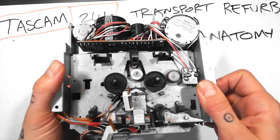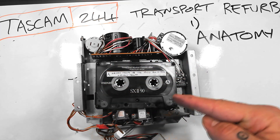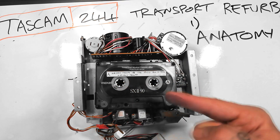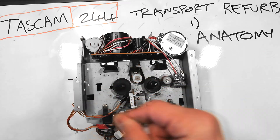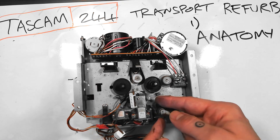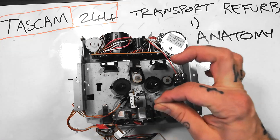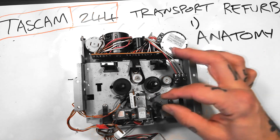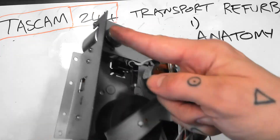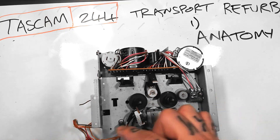I'll just simulate that by manually turning that white wheel at the back. Your cassette is sitting there and it's travelling around here, going past the magnetic heads and through to here. So this would be your supply reel and your take-up reel. That movement is created, at least partly, by this pinch roller — this rubber part here — pressing against the capstan. The pinch roller doesn't have any movement driving it; it's just there to create pinch so that the capstan will tug the tape through at even speed past these heads — this being the record and playback head. That's what the capstan motor is doing; it's the main one responsible for ensuring an even tape speed.